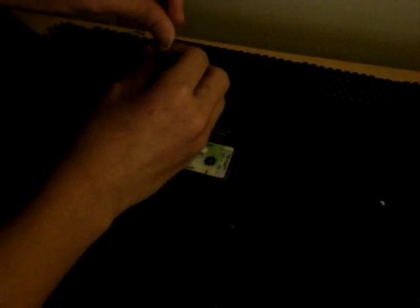So now what you want to do is take off the cover for your network card. Your network card is located where your Windows verification sticker is. Now you have to take your Phillips screwdriver and unscrew it. You will have to use your Phillips, otherwise it would be really hard and you might shave away the grooves in your screws. Now it may be a little difficult, so apply some light pressure on the screws so you can get it out. So just get that off.